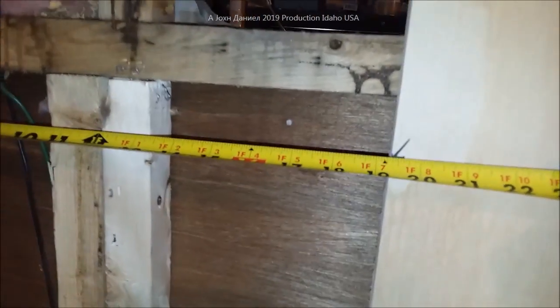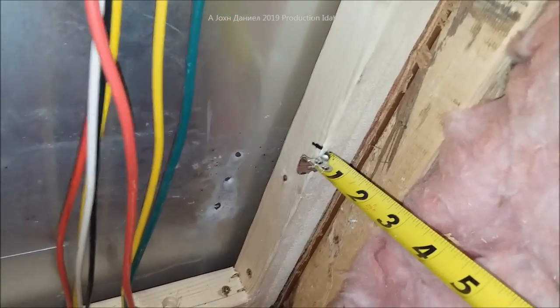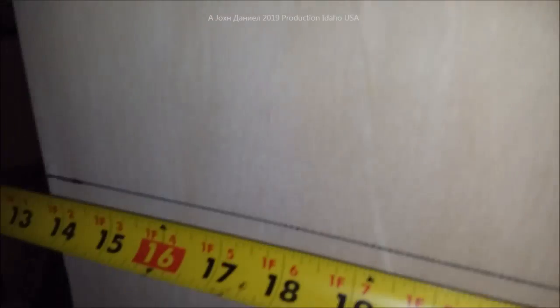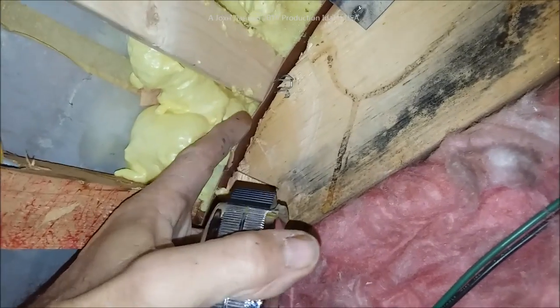Now, the way that it works to cut this in here, and then a small piece of cardboard to cut in a template for that point, we will take the tape measure here, and I'll show you that up here in the front, I am exactly 19 3/8 of an inch to my point. So what I've got to do here is catch the next one at exactly 19 3/8 of an inch, right there on the line. And then this one higher up, you see the angle increases to 19 3/8 of an inch, keeping the distance the same as that furthest point all the way up. When I get up in here to where it starts the angle, which is about right here at this point, of course we'll have to take a piece of cardboard and make a template.